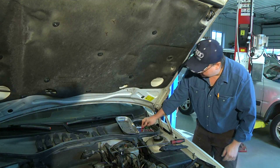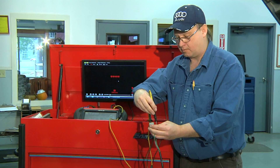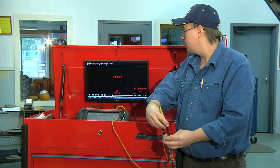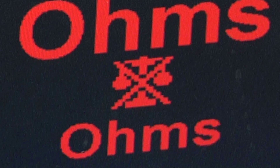This is difficult to see on video, so I've made a short piece of wire that we'll pretend is our fuel circuit. If we ohm the circuit from the fuel pump to the relay, we should have continuity or no resistance, and our meter indicates that we have no resistance or continuity.